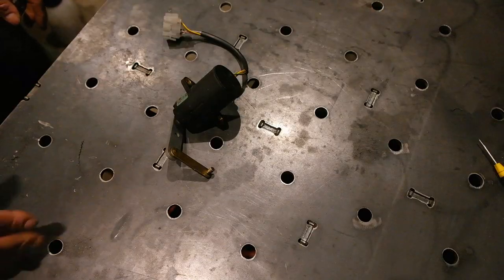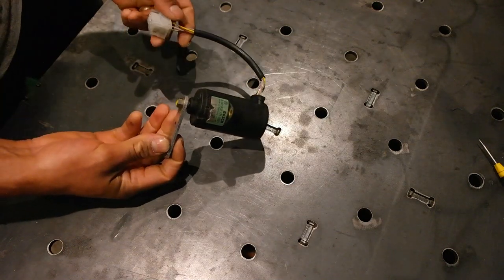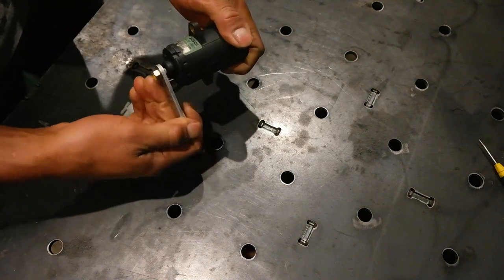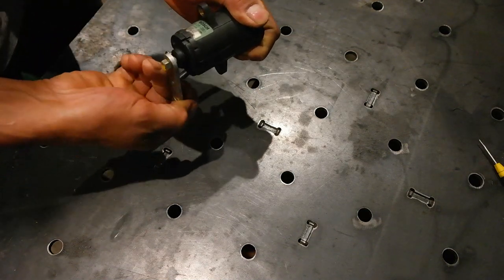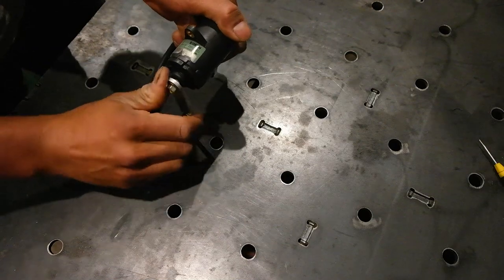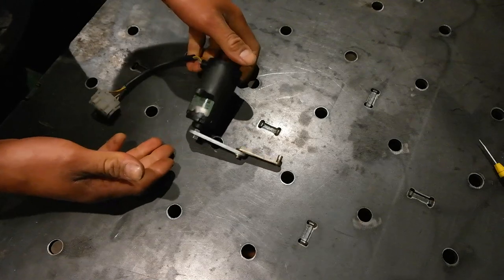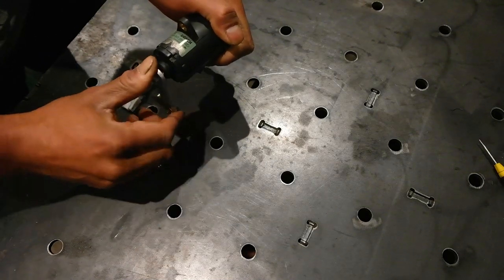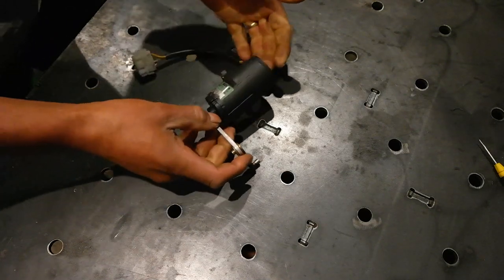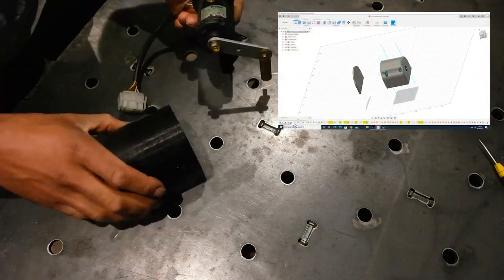One of the things I wanted to show in the next video is this cylindrical type potentiometer. This is the one I wanted to use in my car to experiment with. It operates right down to kick-down — I was going to put a stopper on it to prevent it reaching that point, since I don't know what would happen at kick-down when you're no longer using an automatic transmission and the transmission control is not connected. My intention was to only use the part of its travel that would actually accelerate the engine, which goes right up to 100% throttle. I designed and 3D printed a housing that this potentiometer fits into.